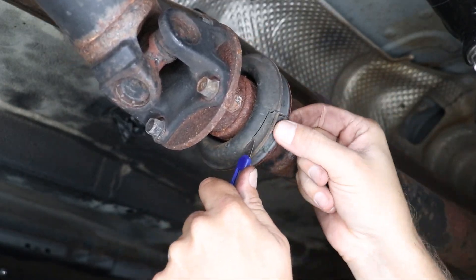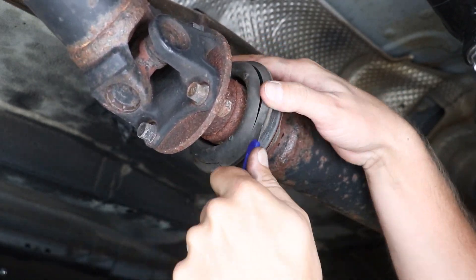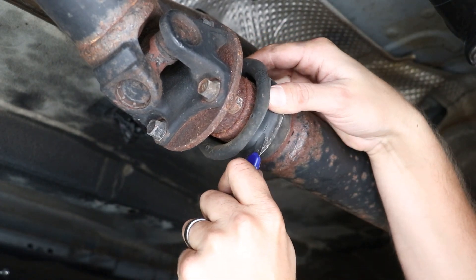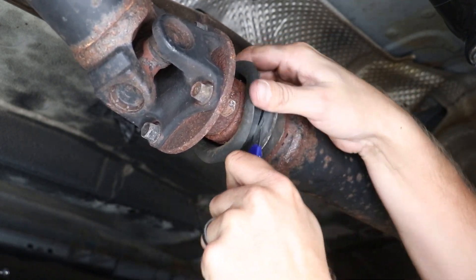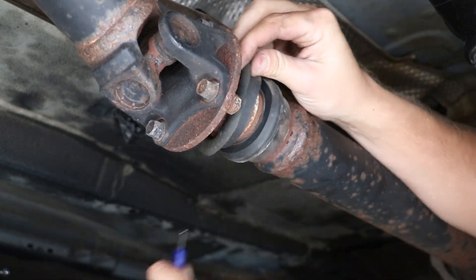With the main carrier frame removed, now make a cut all the way around — that's going to allow us to get the last metal ring off. Next, cut off all the material in front of the bearing. Feel with your thumb to where the material starts to get soft and cut everything off in front of it.